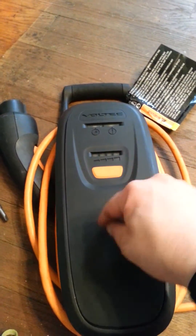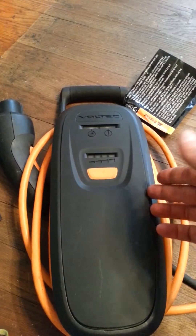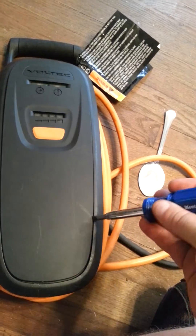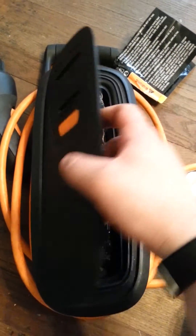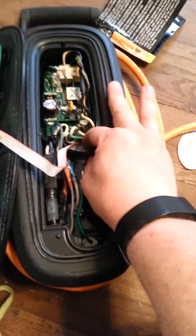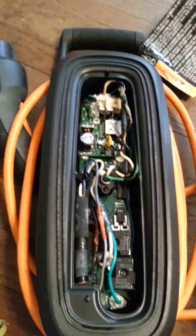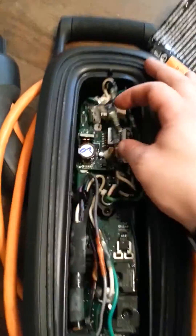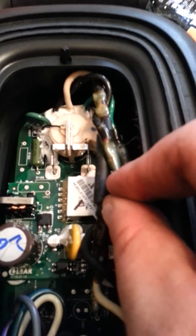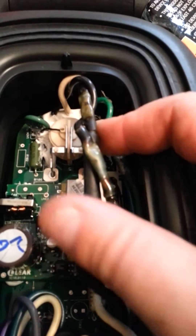From what I found out, there's an internal fuse in this charger. What you have to do is take a screwdriver, pry this plastic part up here and it'll come loose. To give you a little bit more room, you unplug this little cord here — just be careful with that. Set this to the side. The fuse that went bad is — you can see here — there's heat shrink tubing and there's a fuse inside there, and that fuse has gone bad.